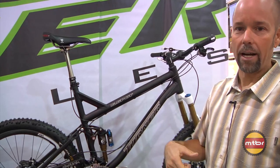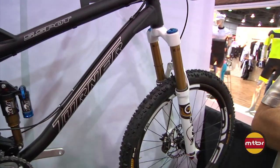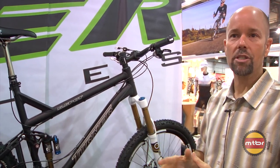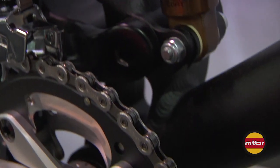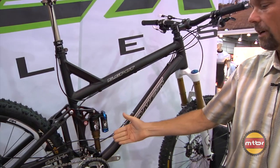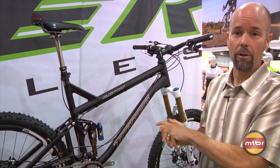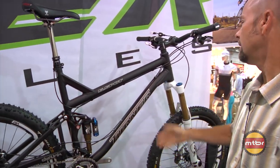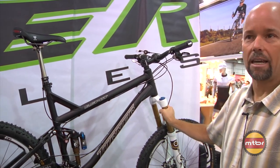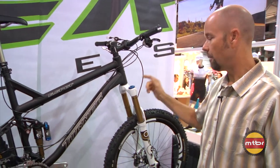One of the options we're offering is the bigger fork on it for the enduro crowd. There's really a shift in how the bike is used. Some guys ride it more cross country and don't use the ISCG tabs. But because we place the ISCG tabs in a couple of millimeters, if you drop the chain it doesn't bind. Some manufacturers are putting the chain guide mount right on the face, and that ends up being a really bad bind if you drop your chain without the guide. For the trail rider: inline shock, no chain guide, tapered steer tube fork, external bearing headset with a 150 fork.